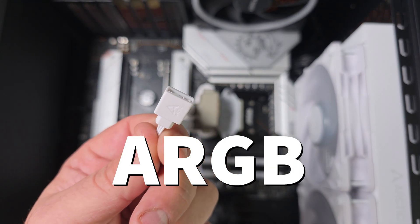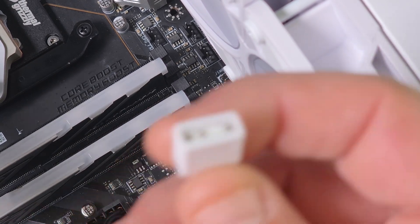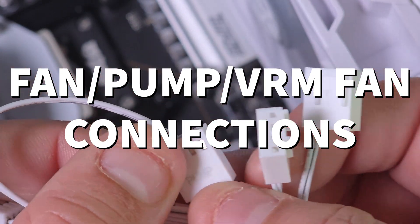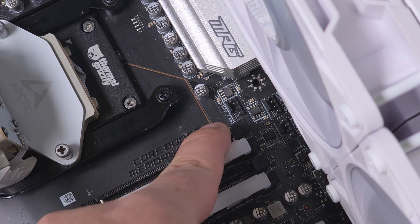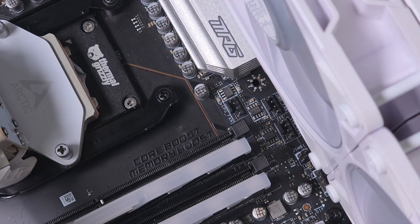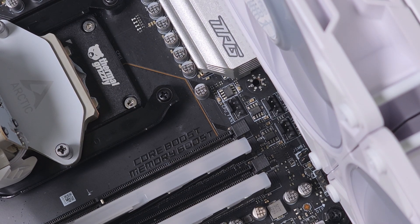For the ARGB header — you can see the header here, line up the pins and push it on until it's done. The connections here have three individual ones for the pump, the VRM fan, and the CPU fan. The CPU fan header is usually close to the CPU itself, and the pump header is just up from it. Take the four-pin for the fans, put it in the CPU fan header, put the pump one in the pump header — and that's it for AM5 installation.